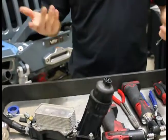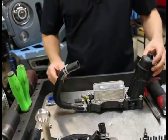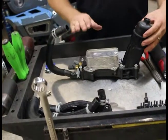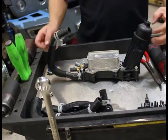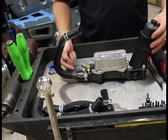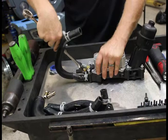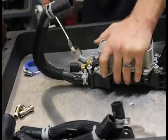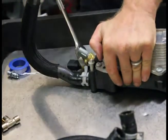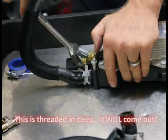At this point we're going to put our oil feed line in. This is what we removed out of the valley of the engine, under the lower intake manifold — it's our oil cooler. The oil filter is right here. It's got O-rings on the bottom — don't disturb those. We've got to get the oil pressure sending unit out. I'm going to use an inch and a sixteenth wrench here. It's a little tight to get started but it comes pretty much right out. Use a socket over the top if you have that.